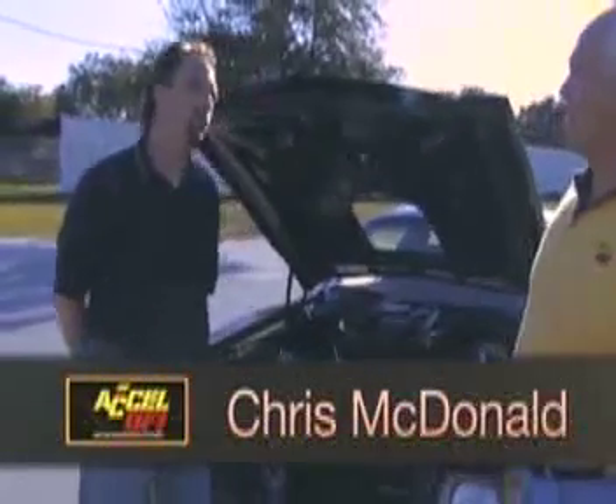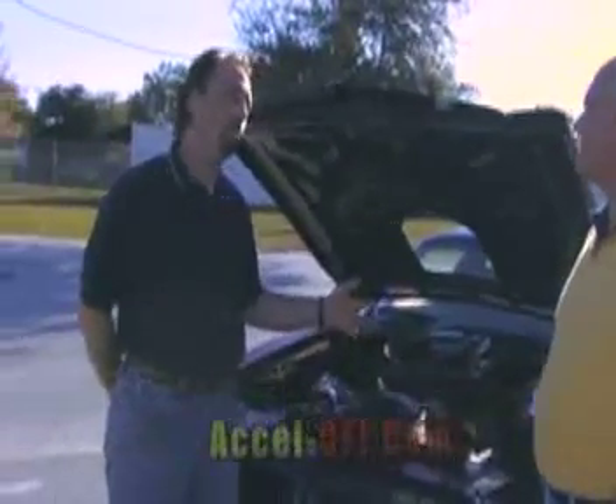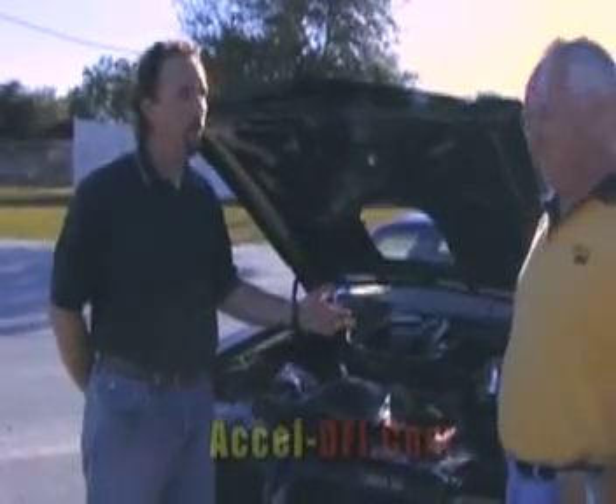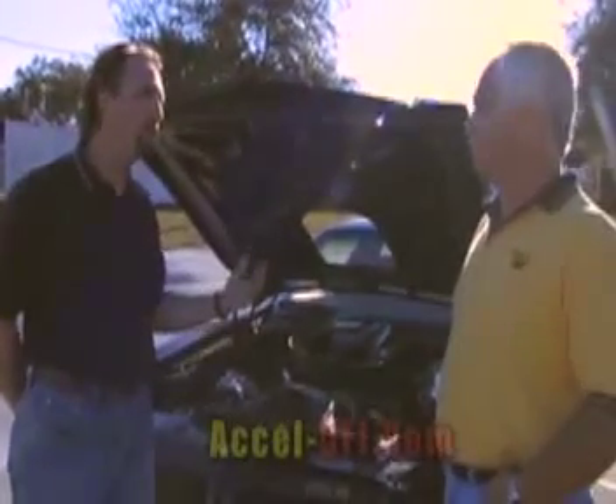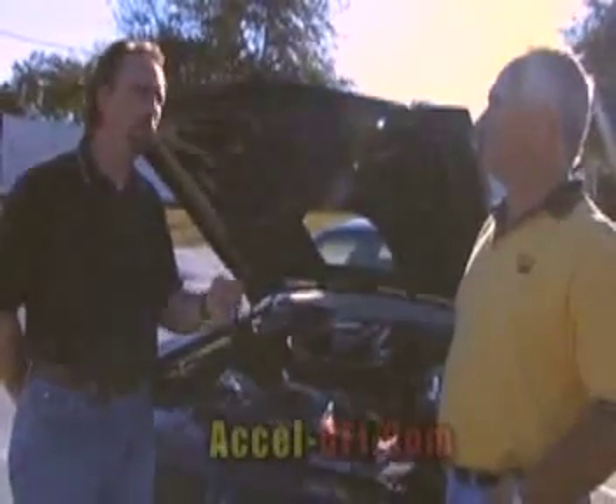The next car that we have here today is this 1976 Trans Am. This car is featured in Pontiac Enthusiast Magazine as a project car. The person who spearheaded the project is Chris McDonald. This Trans Am belongs to Dr. Andrew Hall. He was looking for the best of both worlds. This particular car is running something a little unusual — we have a 2.41 rear gear, a 700R4 transmission with lockup, and a Pontiac 400 with custom aftermarket aluminum cylinder heads. The challenge is how is this thing going to go down the road at 1500 RPM at 70 miles an hour if you don't have total tunability. Our desire for this system was to find something that would give us low end torque, tuning capability, upper end high performance, and steady cruising capacity. We now have total drivetrain control between the torque converter, the electric cooling fans, and the air conditioning system. It's a complete package to give you modern muscle in a vintage machine.